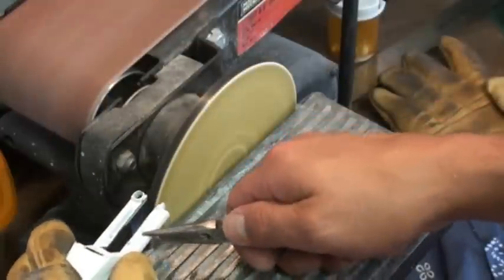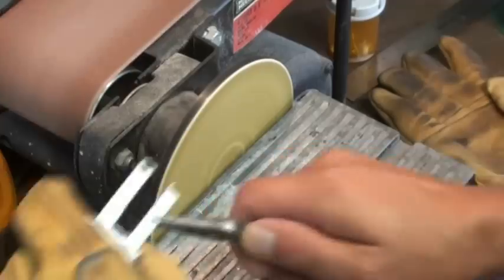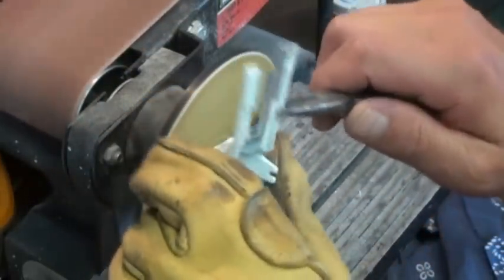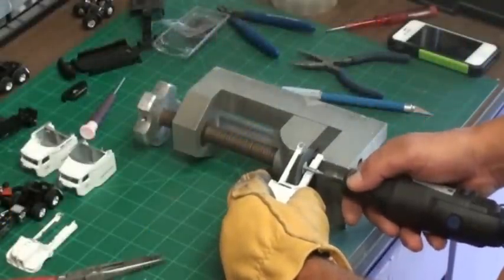The T600 body did not fit my new frame perfectly. To clean up the cut lines, I took the body to my disc sander and removed metal on both sides of the body until the frame fits snug. A file or Dremel would accomplish the same task.